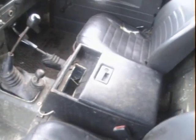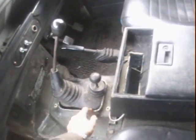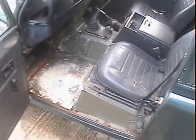It's obviously had a patch in the floor on the near side footwell — looks like it's quite well done though. Inside, standard Landy interior. The seats are slightly torn on the passenger side and on the driver's seat cushion, but the backrests are fine. It's got a center cubby box. The dash has a couple of extra switches in it, and the transmission tunnel cover just needs its cable tie. Still olive green inside — not original but still the right color. The near side rear wing is all fine and the near side van side is all good as well.